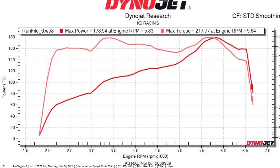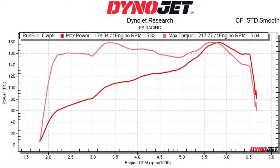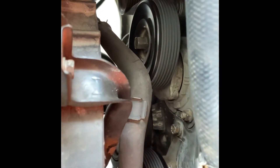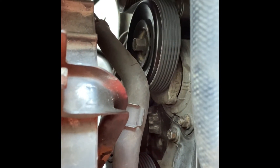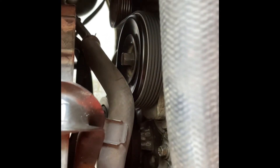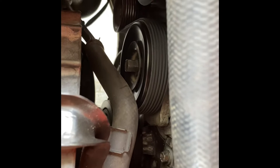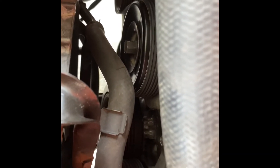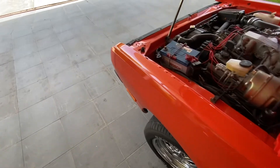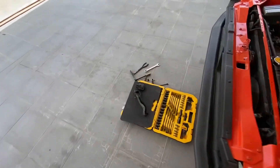There you have it — you can see the dyno. After the dyno, I started checking the base timing because I thought maybe it had jumped or something. But you can see it's bang on where it should be: 15 degrees on idle. So it's all good.